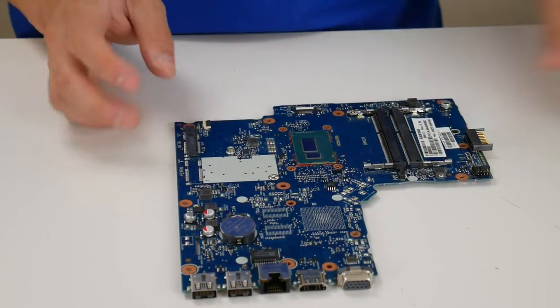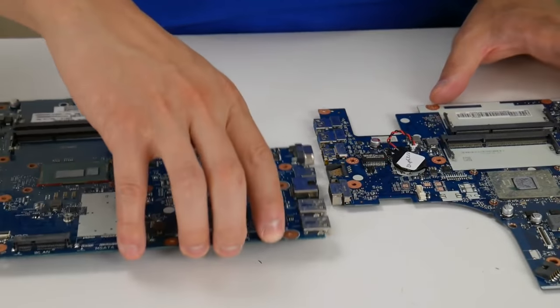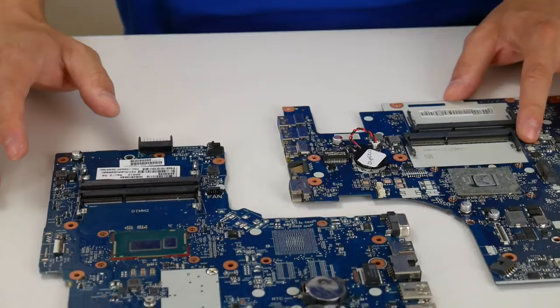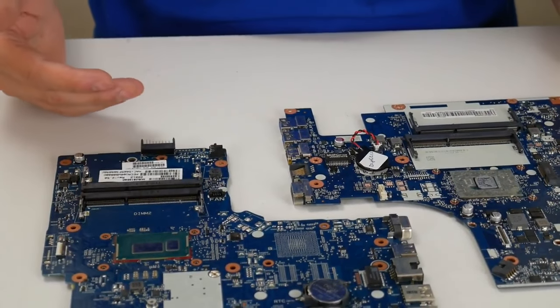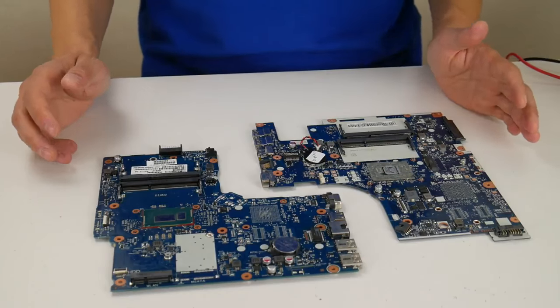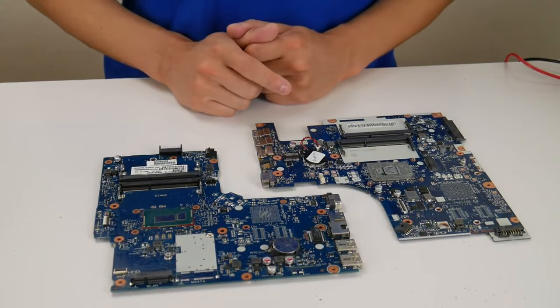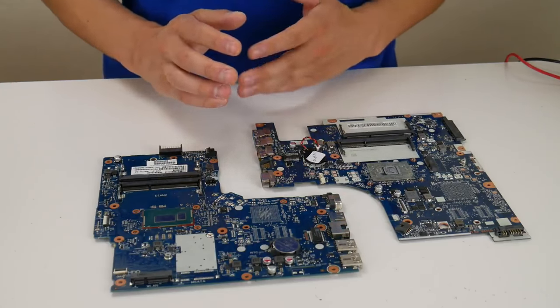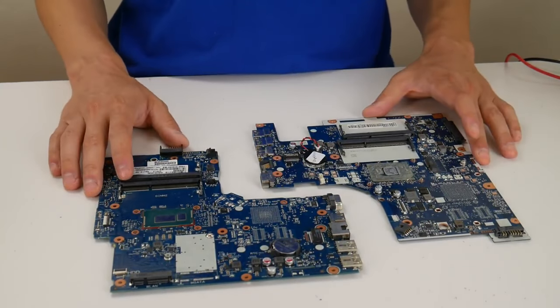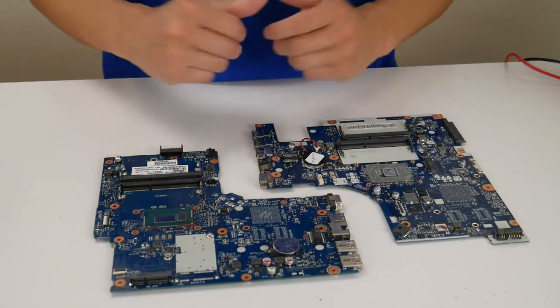Now that is a pretty relatively easy procedure. But after you've done a BIOS reset, you have to go back in and change some settings so that BIOS can function properly. In order to do that, we have another link in the description — it'll show you how to get into your computer and adjust some date and time settings to make sure that you're not going to get a CMOS checksum error the next time you start your computer because of this reset.